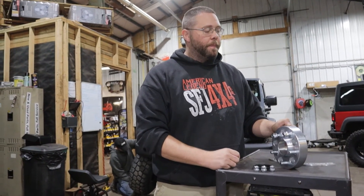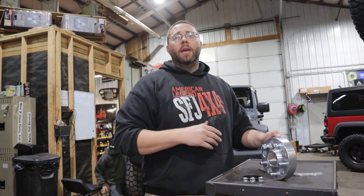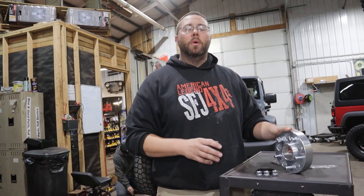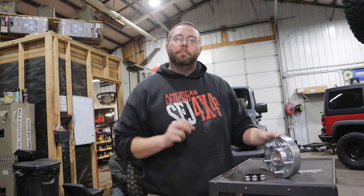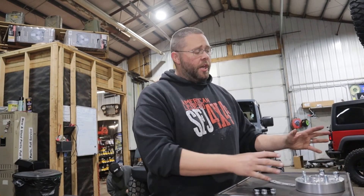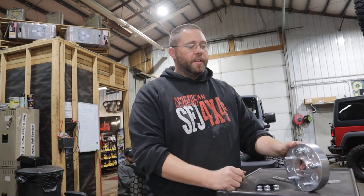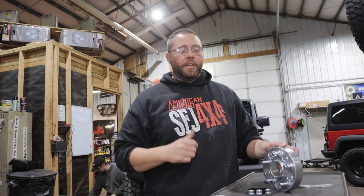That's also what you'll see most manufacturers recommending. Once they're installed, leave that wheel adapter alone. We typically encourage customers to check their wheels between 150 and 200 miles every time, no matter what — that's just a best practice. Break out your torque wrench and make sure they're at the appropriate torque. That's specifically for JKs and TJs. For JLs and JTs, you're actually at 120 to 130 foot-pounds. The Jeep going on behind us is going to be at that 100 foot-pounds.